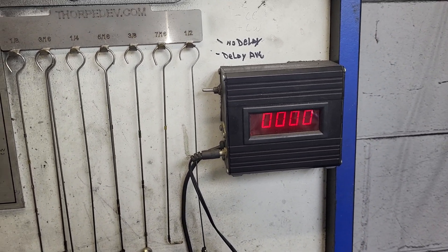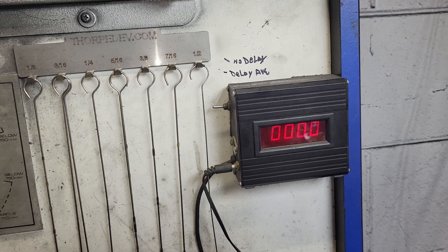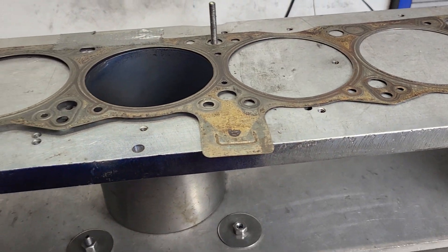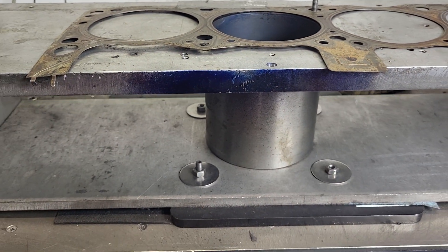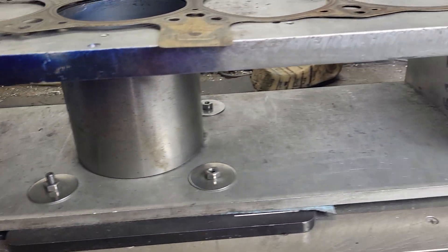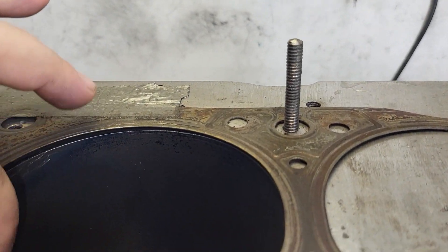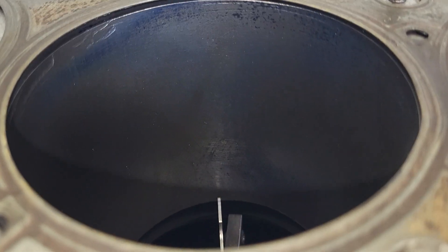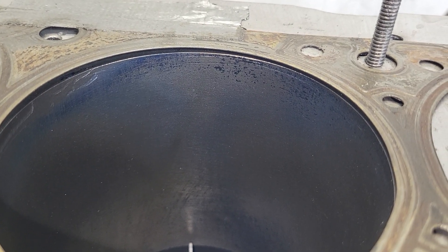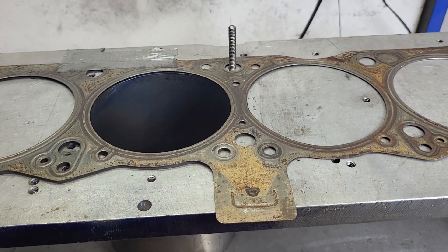This one has an old-school swirl meter. We'll show more about that when I take the bore adapter off. My bore adapter was probably made by Brooks — you can still see the magic marker marks on it where the guy measured it out. He did a nice job: nice and straight, nice machined bore. You can still see a little blue on it from my last flow test as well as the old 318 head gasket that was used to seal it.